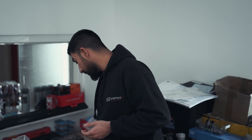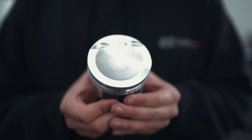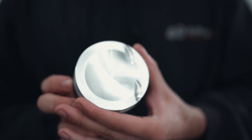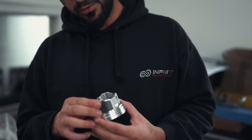From there we've got our Stage 2 build. On our Stage 2 builds we upgrade the pistons. This is a JE piston — it can take a bunch more torque. We would rate it up to 1,200 Nm, along with our upgraded rods.